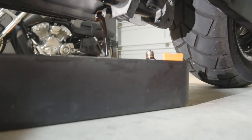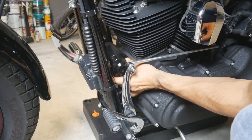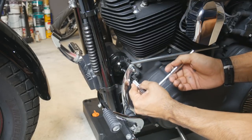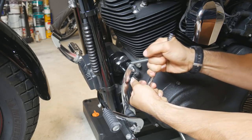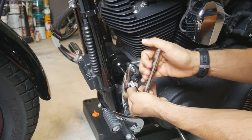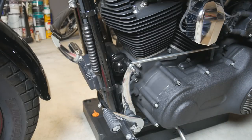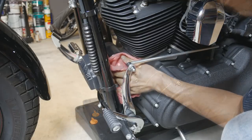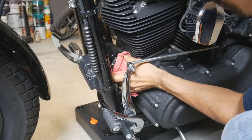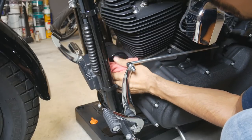You don't need to sit here and wait for it to drain completely before you move on to the filter. So the first thing you do is take your filter socket and get it placed onto the filter itself. Here comes the ratchet with that extension arm. Trying to do this without the extension arm is perhaps possible, but it's really helpful to have that extension to get just the right angle and get in there and get it loosened up. Once you've gotten it taken off, you've got the pan directly underneath where the filter is going to be coming off to make sure you're catching drips. This thing's going to be hot, so having a rag on hand is helpful.